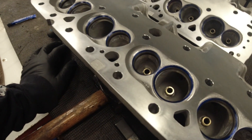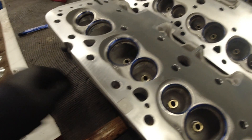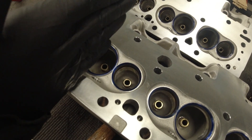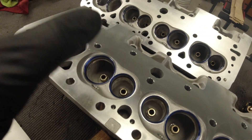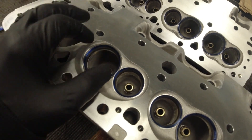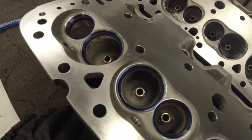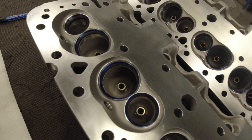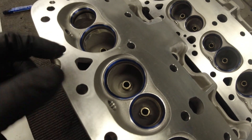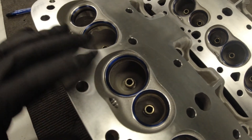I'm not running a hot car or anything — it's just a stock 350. But my concern was, if that valve is off eight to ten thousandths, that's four to five thousandths off the centerline. It doesn't sound like much, but every time that valve opens and closes it has to bend over to line up with the valve guide and the valve seat. You do that thousands of times per minute over several minutes, days, weeks, years — you flex metal, it fatigues, it breaks. It could take a thousand years, it could take a day, depending on how bad it is.